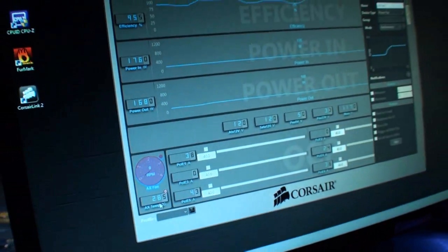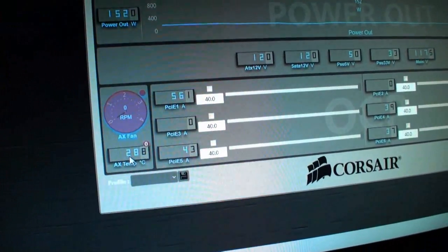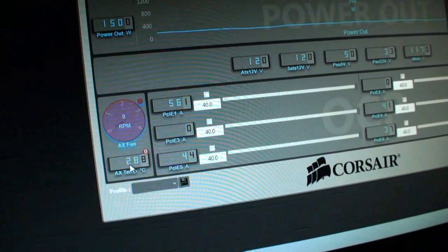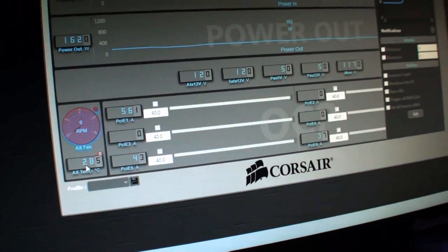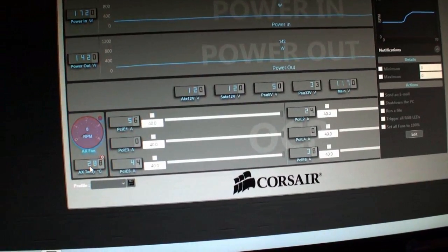One of the things we can also do is monitor internal temperature and monitor the separate voltage regulation. With a normal power supply, it has to anticipate when the load is going to happen and what the voltage drop over the cable length is, then handle that analog. This is a digital power supply — we know how long the cables are, we know the voltage drop across the wire, and we can adjust the power delivery digitally so voltage regulation is extraordinarily tight.